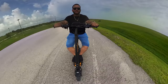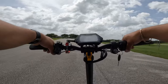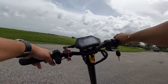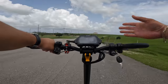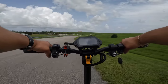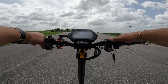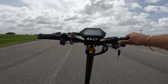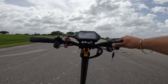Now we're doing an uphill test and doing about 22 mph on mode three, dropping to 20 mph — it does get a little lazy in the sense that speed decreases. It's not like dual-motor 48-volt scooters that maintain speed better, but for this single 1000-watt motor I have no complaints. On the roughest side of the incline — about 18 percent grade — starting from scratch it picks up to 10, 11, 13, 14 mph and just continues to pick up.